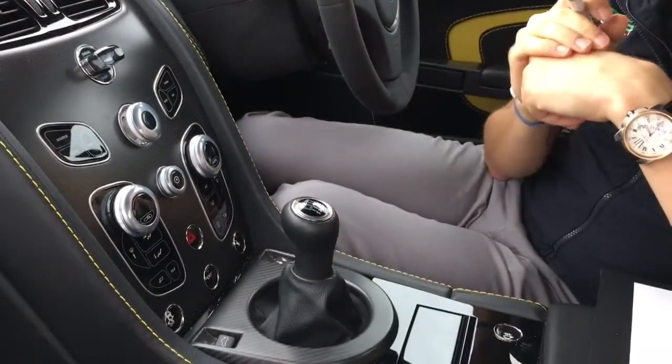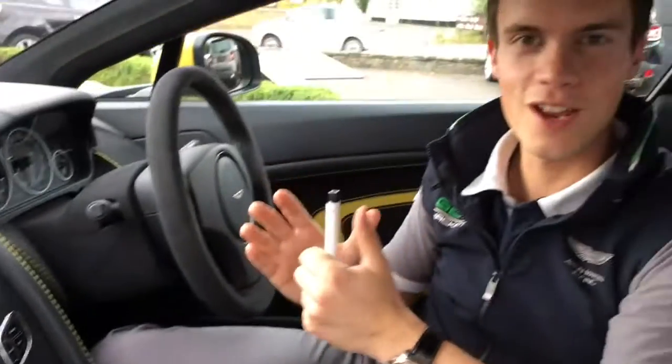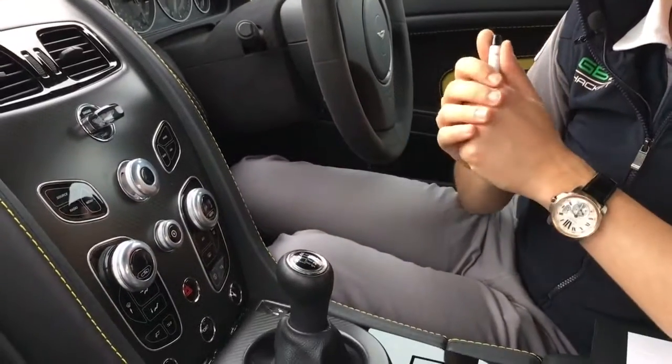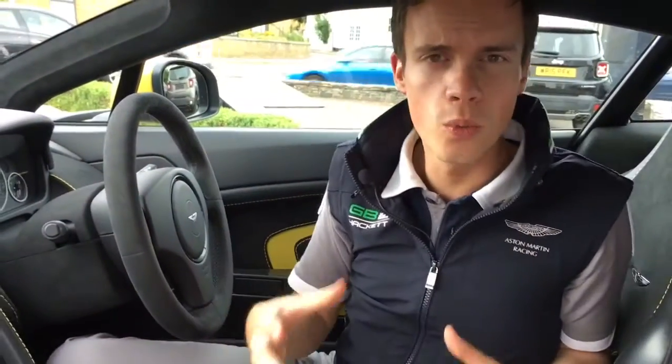The punchline of the new V12 Vantage is this, the 7-speed manual gearbox. So we have three pedals, a very old-fashioned configuration, we've got a clutch pedal to work your leg out, and a quite unusual 7-speed manual gearbox. Now, the innards and the workings behind it, it's actually based on the 7-speed sport shift that's seen service in the V12 Vantage S since 2013, but has been redeveloped and re-engineered for service in this new version for the